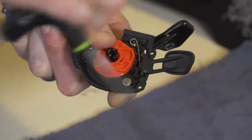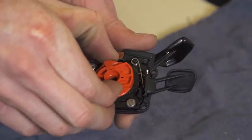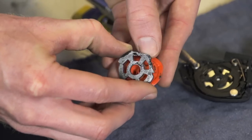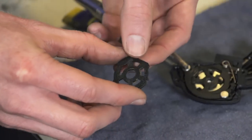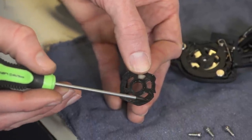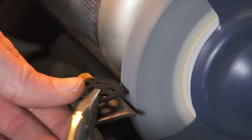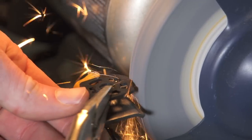Then use a pair of five-millimeter allen wrenches to remove the bolt that is holding the shifter internals to the cable uptake lever. Now remove the plastic cable pulley assembly. At the base of this assembly is a metal plate with teeth on the edges that serve as an indexing mechanism in the shifter. These teeth need to be removed — remove the metal plate from the shifter.